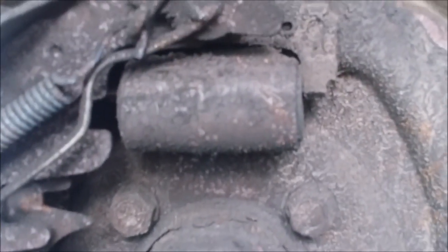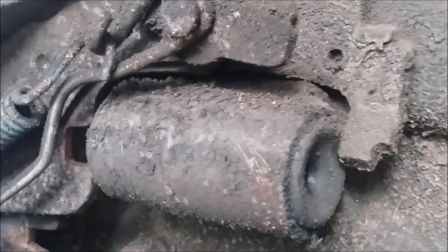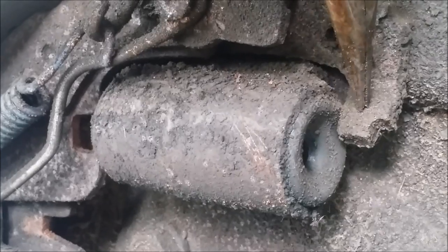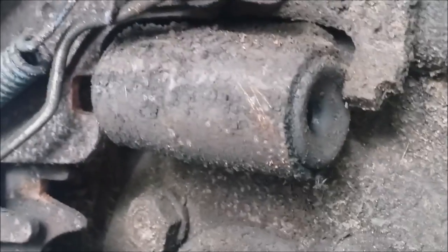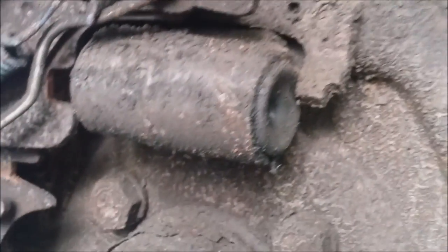You've got to work through a small gap between the drum plate and your leaf springs, but it's pretty self-explanatory where that is. The reason these fail and start leaking is because of this bracket design right here. This piece on your cylinder is rubber, and this piece right here is steel. When this pushes into this enough times, it eventually wears through and cracks the rubber, which causes leaks on both sides. If you have leaky rear brakes, it'll eventually get to the point where your brakes do not hold pressure at all.